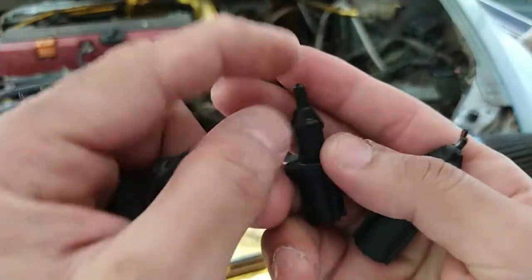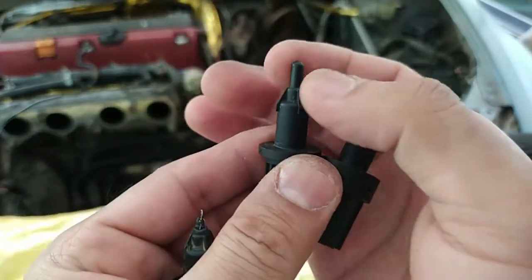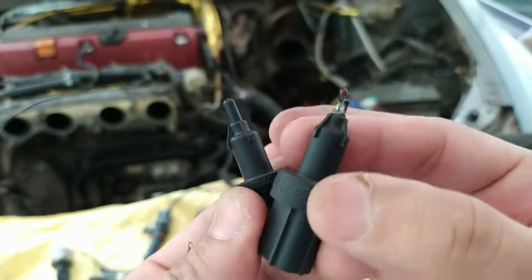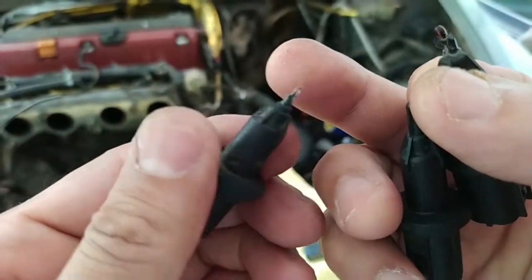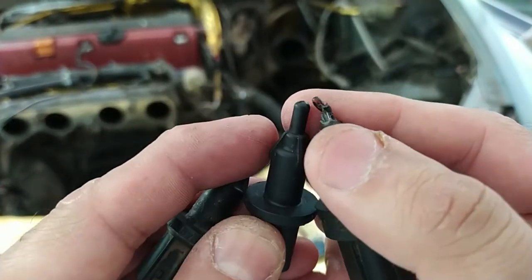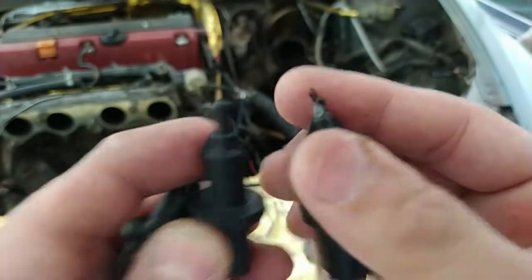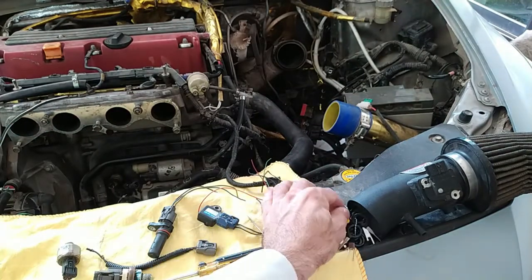Another trick: the plastic casing on the IAT sensor is usually thick, so the sensor is slow to respond. What you need to do is slightly shave off that plastic with a cutter blade to expose the glass filament inside. Then the sensor is super fast. But don't overdo it — otherwise you will destroy the sensor. Just slowly, with the cutter blade, cut the plastic and make the glassy filament exposed.